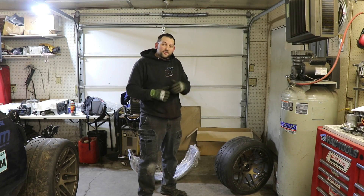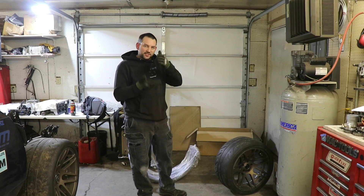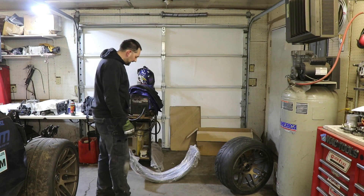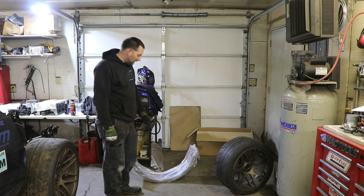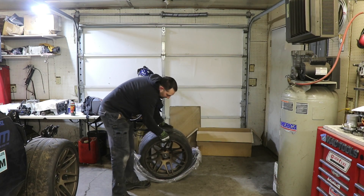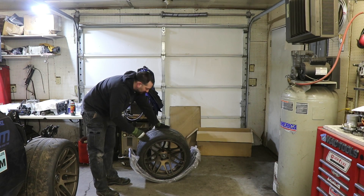In order to fit a full size spare tire, I need to drop 10 inches below the floor, which is going to be right around even with the bottom of the gas tank - maybe still up higher by an inch or two. To do that, I'm going to take a design from guys that do wheel tubs with trailer fenders, except I'm just going to use it to mount my spare tire. It'll be big enough to have extra room, and I'll use two fenders cut and widened so the tire can slip down in there.